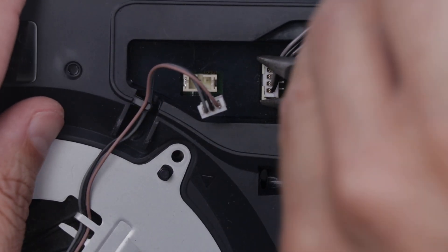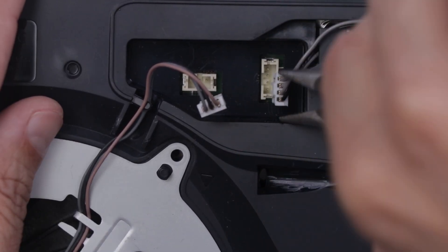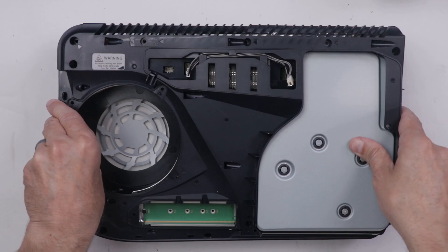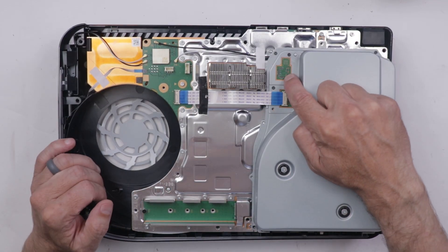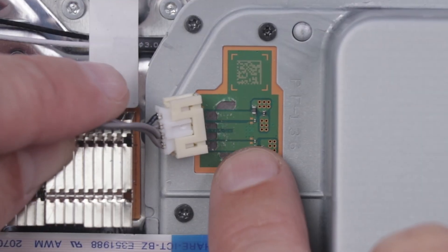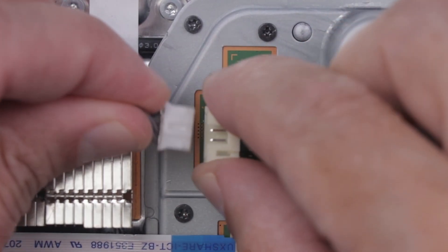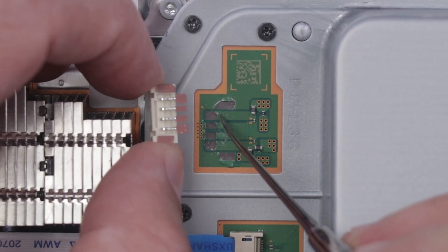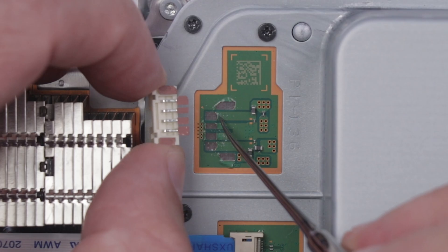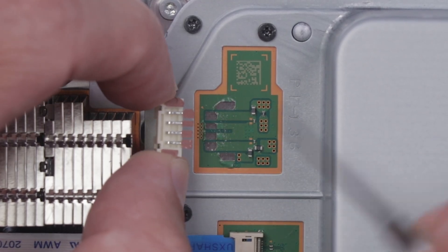I will put my pliers right there, making sure they're not pulling on the off-white piece, and then pull straight up. Same with this connector over here — if it's tight, we can wiggle back and forth as we pull up. Then we can remove this black mid-frame piece. Now that we have that removed, we can see the damage on the disk drive board. This off-white piece right here should still be connected to the board — clearly it's not. And these little brown patches are the copper pads that were attached to the board. These copper pads are where the current flows from the various parts of the board that need to give the disk drive power.